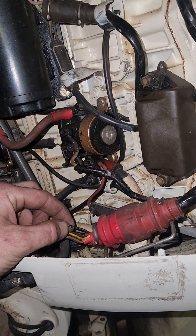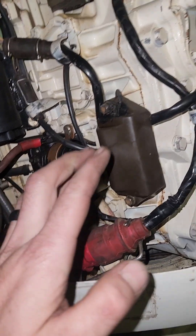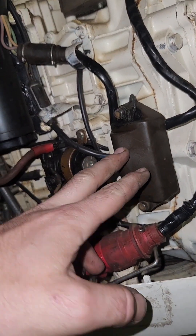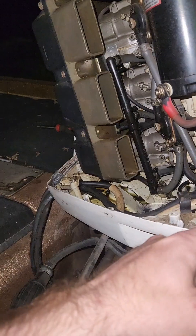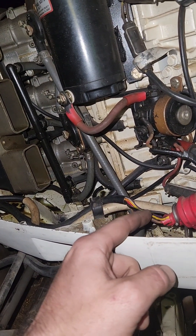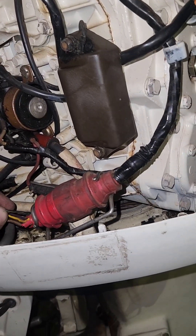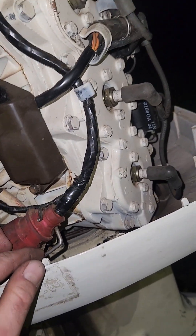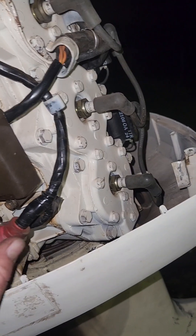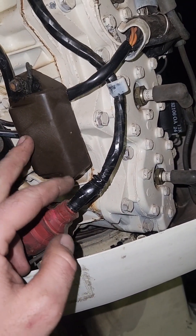If you ground this out and it does not kill your engine, then that means most likely it's going to be a coil pack or a power pack. What that key does is it signals this via ground to kill the engine — it sends a signal to tell it to ground out. I'm not 100% sure on the specifics of whether it grounds the spark out or what exactly it does. But this signal routes up through these two power packs. There's one on each side, one for each head.